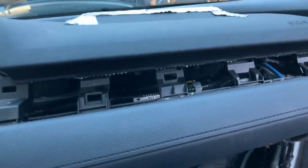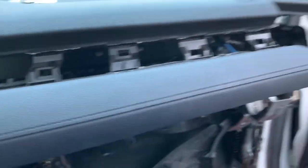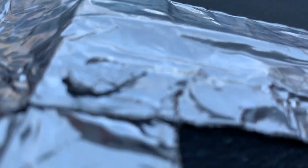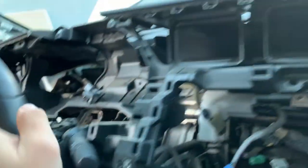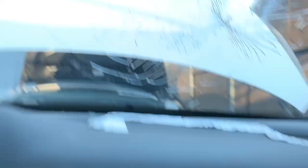The whole dashboard is now basically removed. As you're pulling it out, be careful not to accidentally damage any harnesses or wires — pull them back underneath. We also need to take care of this connector here first. Move your steering wheel down. There's an easier method to pull it out since our glass is damaged, but I don't have it fully removed at this point.